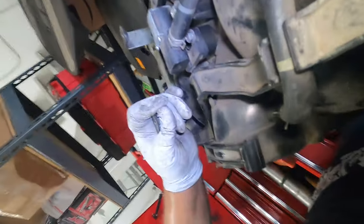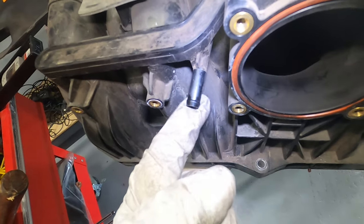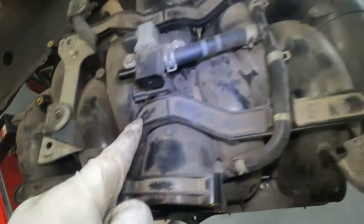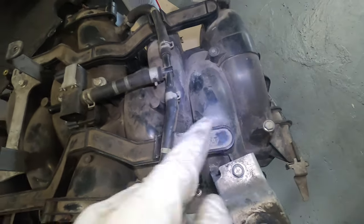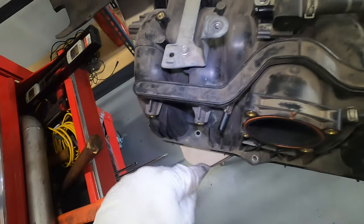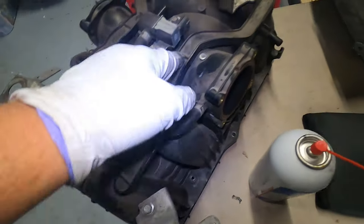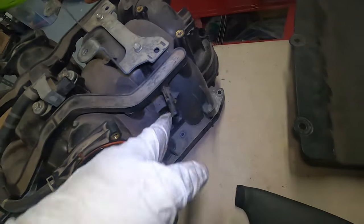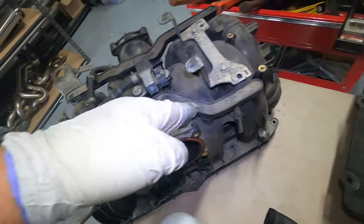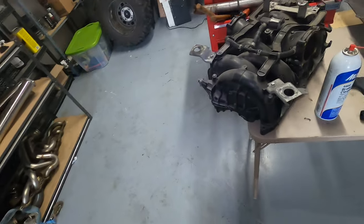What I'm hoping — if we look at this wall as if it's on the engine — is that we spray seafoam in here, it comes up into this manifold, and it goes off to each one of these intake runners: boom, boom, boom, and boom, and it sprays directly into the cylinders. Same thing on the other side — same manifold, same fitting right there — goes directly into each cylinder. And with any luck we get it clean.